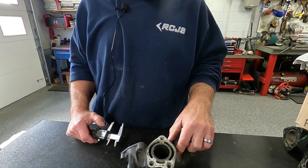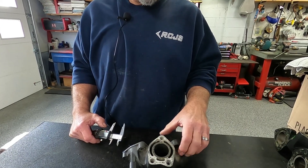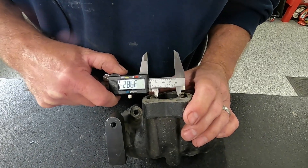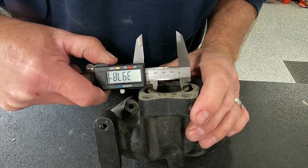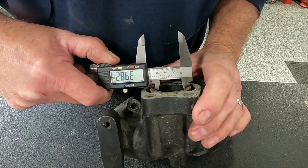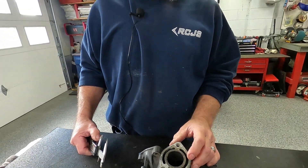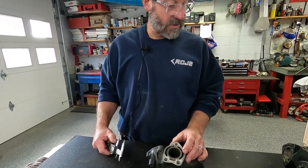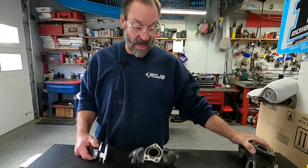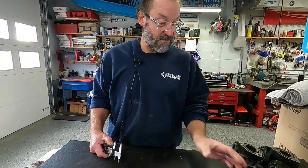There is a later one that is silver. I don't remember if it came on the Kawasaki standup — I know for sure it was on the TS, maybe the X2 — that has an even bigger opening. This one measures very much the same; we're within splitting hairs here, but this one's about 39.8, we'll call that 40 millimeter. I think the other one is like 42. The silver manifold is the most desirable. These black non-diverted are okay, the black diverted are better, and the silver 650 manifold is best — as far as stockers go.